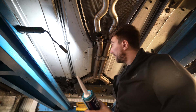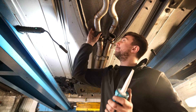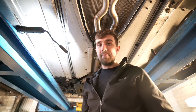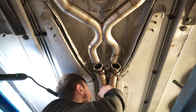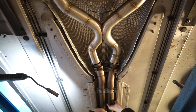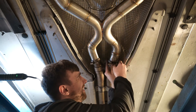Now that the front is successfully bolted up, you need to attach the cross pipe to the rear. Get some more sealant and put quite a decent bead around the edge — the way these work is almost like a ball-and-socket joint, so when you push them together the sealant creates the seal. Do this regardless of whether you've gone for the 200-cell cat option or the no-cat option. Put this part of the exhaust back in its hanger, then push the parts inside so they seat together, and get your brackets and slide them back over the joint.